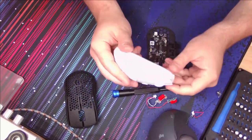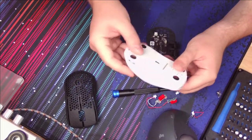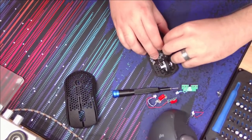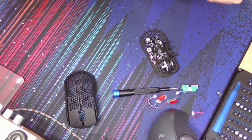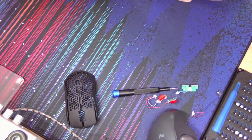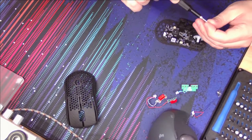So when modding this mouse, the side buttons ripped one of the solder pads off of the board, so the buttons stopped working. And the guy who's in chat now, who is a legend, actually helped me fix it by adding a couple wires. So basically, instead of using the PCB to carry the signal, he just instructed me on how to figure out where to put the wires, because he has a much larger brain with more wrinkles than I do.